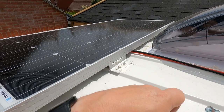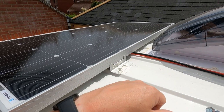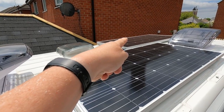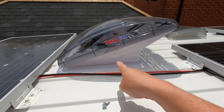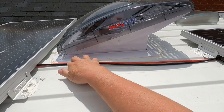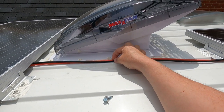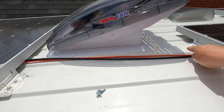When it is raining, the water's going to run down these troughs as opposed to on the top, so it shouldn't be too much of a problem. I've connected these in series — you can see a cable coming from this one, which goes into the next one, and then goes off to the one at the back. The only bit where the cable is really visible is from this front one to the back one. I'm going to find some method of fixing that up next to the max fan, so it's not dangling down in the trough in the water — just get a couple of sticky cable clips and stick that up there.